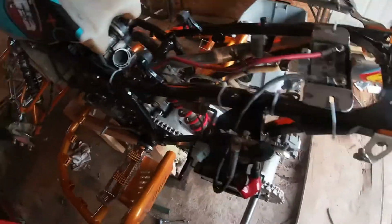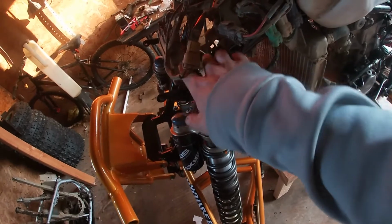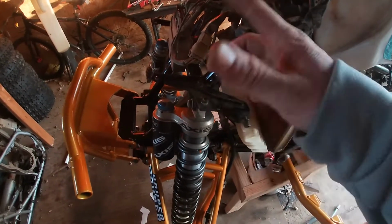They do make kits, 24-volt kits, tons of companies do, that go up here and use this piece of the frame where it goes across in between the headlight mount, and they come with accessories for all of this stuff up here so they aren't just dangling around. I ran one up here last year, and it worked fine. I made my own wires for it, actually at Lowe's, really cheap. I think I had probably less than $30 in all the wiring for it.